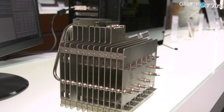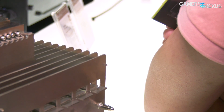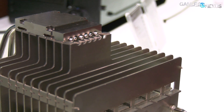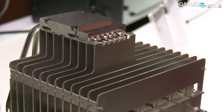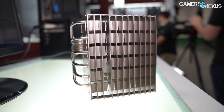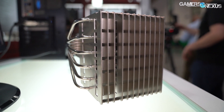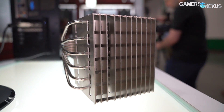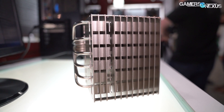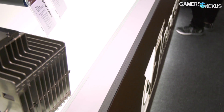The target release date is pretty far out, so this is an early prototype and Noctua is still doing a lot of tweaking. You'll notice in b-roll that the fins are actually spaced pretty far apart — this is intentional. When you don't have a fan with static pressure to force air through the fin stack, you end up with a worse scenario for passive cooling. So what you want is a bit of space between each of the fins; the fin density is lower so that natural convection can take its course — you're relying on just physics at that point.